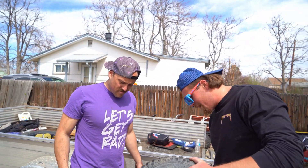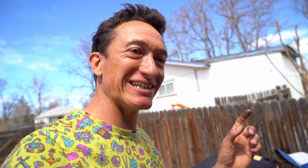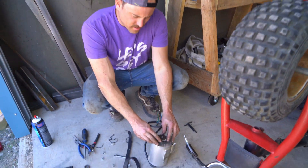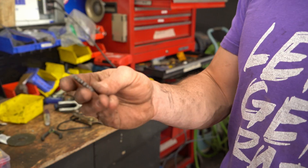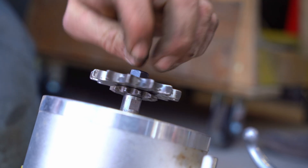They're very rare, but we got to do it. I think we just steal this sprocket, and if we're really lucky it'll be the same size diameter as our motor. So we're about to destroy another 70 to make this one work? The little sprocket fits on our motor, but the big sprocket is what we need to run the original Honda chain. So in theory, if I can weld the little sprocket to the big sprocket right there, we should be good to go.